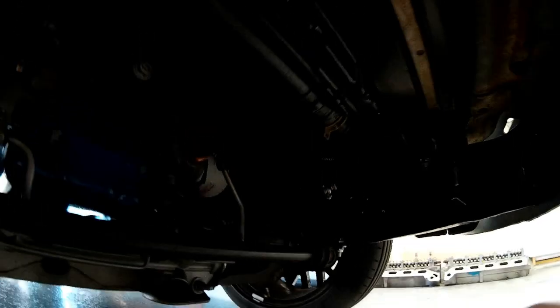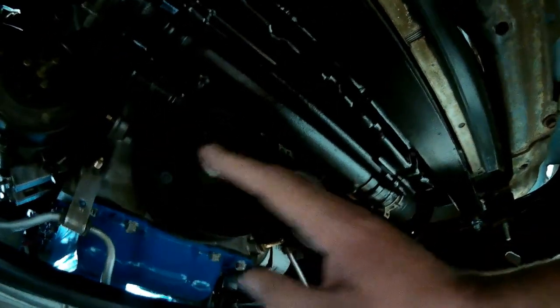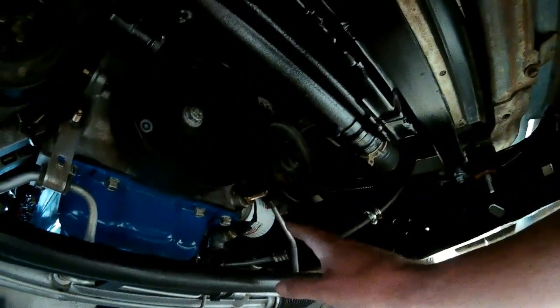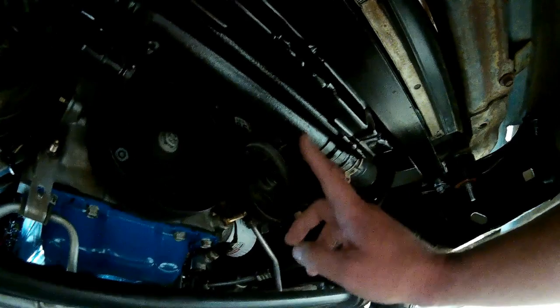You can see how things clear — there's plenty of oil pan clearance, good clearance on the power steering rack, and the front lower control arms are parallel to the ground, so everything as far as angles go looks pretty good. This is the oil cooler mount — if down the road water temperatures and engine temps become a problem, I can plumb in two oil lines from the stock oil filter mount and add oil cooling in addition to the engine cooling going on through the radiator.